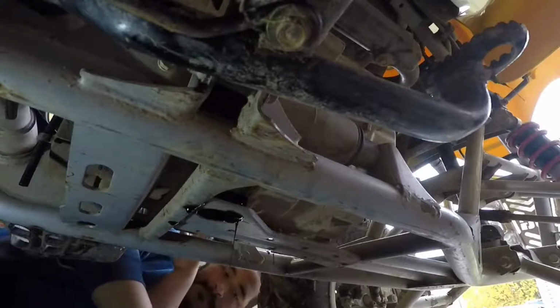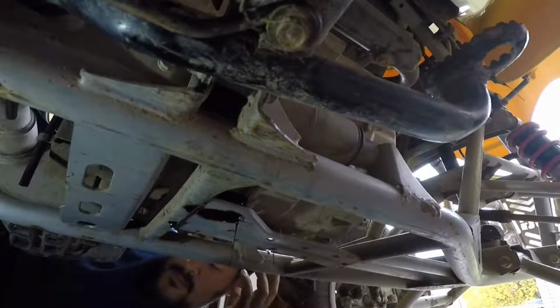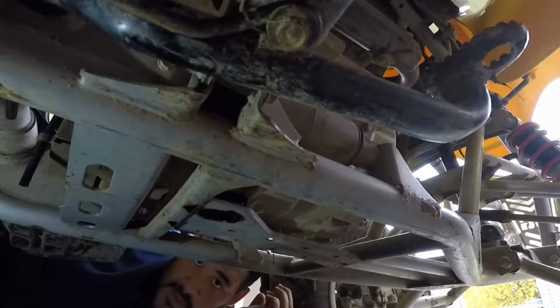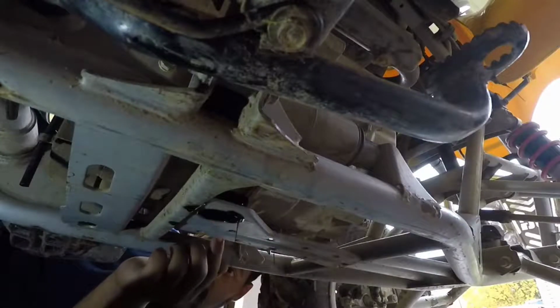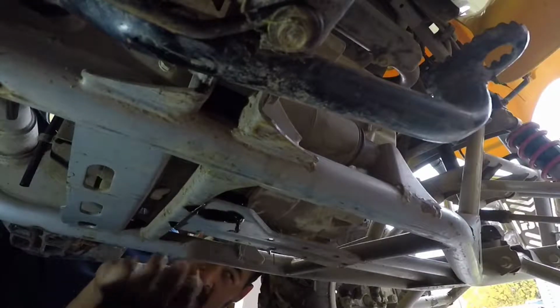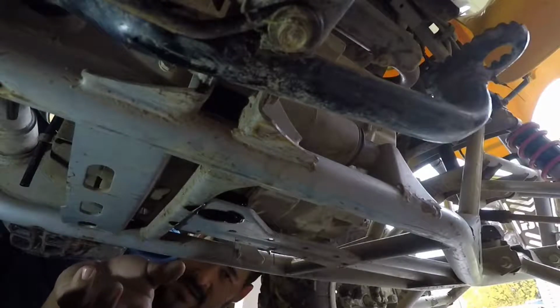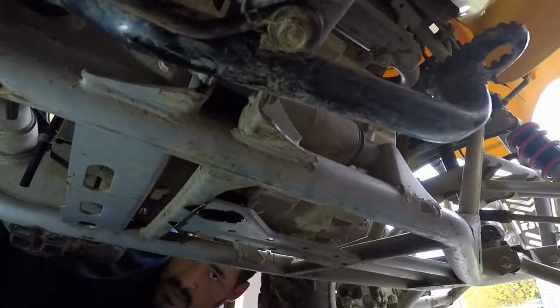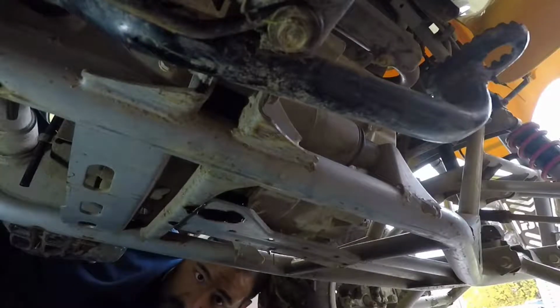And the other thing too is, when you have a motorcycle or anything that has an oil filter on it, the best thing to do is to do exactly what we just did: drain the pan or drain the crankcase, whatever you might have in your application. After all the oil is done draining, then pull your filter off, because if you pull your filter off first, it causes a lot more of a mess, because then you have oil coming out of two holes in the motor. I'm not saying that you can't do it that way, but it's better to drain most of the oil out first, then pull the filter, let the filter drain, and then reapply your new filter, and put in your new or just reuse your old drain plug.